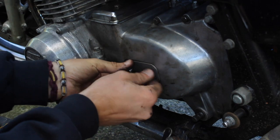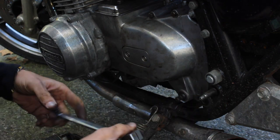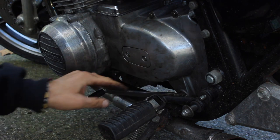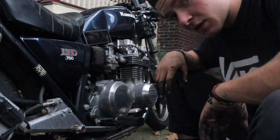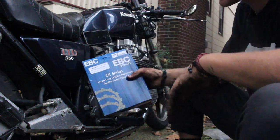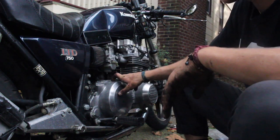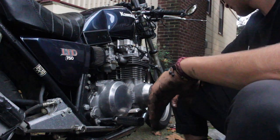Throw the cover back on and of course once you put everything back on you're going to want to put the foot peg and your shifter back on. Considering my bars are so low, I want this to be angled down a bit more so I'll keep this loose until I get on the bike to fit it, but I'll put it back on while I'm here. Now that I did the clutch cable, I'm going to do the clutch plates themselves. I have an EBC clutch plate set — just the fiber plates. We'll have to take off this cover here and the brake foot peg, and I bought a tray because oil will come out, so let's get to it.